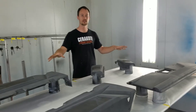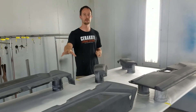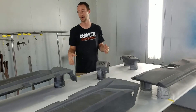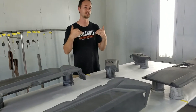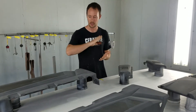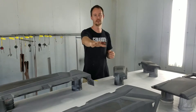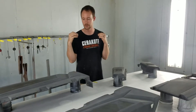On flexible plastics that's what we normally like to do. We're going to spray with the adhesion promoter, then take our epoxy primer — and even though we're not painting metal, it is flexible, and that's where the epoxy primer really helps out. The primer mixes two to one, but we can also add a reducer to make it into a sealer. The primer is about this thick; a sealer is about this thick. We want those smaller coats but in more coats. Whenever we go to spray it, it'll all lay out really smooth. It won't get a lot of orange peel — you know, when you mix up a primer and spray it on and it just looks all textured. You won't see that when you mix it into a sealer; it lays down super smooth and gives you a really good finish.